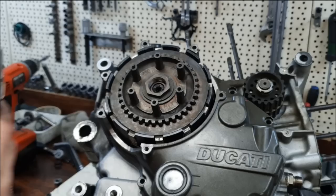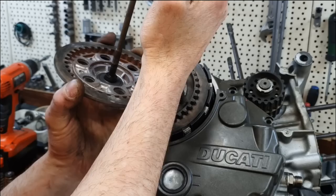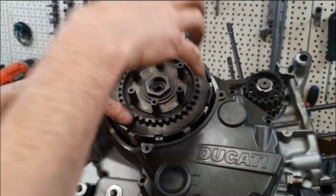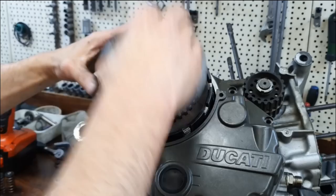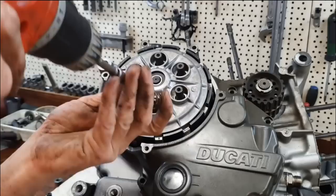Because the pressure plate play that you have from there, to the back, I have to measure it, see if I can get it on camera. It is around 7.7. So if you are at 3.5, you're halfway. That means the pressure plate can still move out and it doesn't drag the rest of the clutch package when you want to try finding neutral. Also, if you one way or the other still have a convex plate in there, besides my modification convex plate, it's gonna do the same thing. It will drag and you can find neutral very hard.